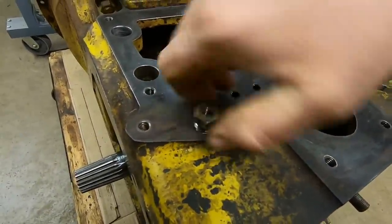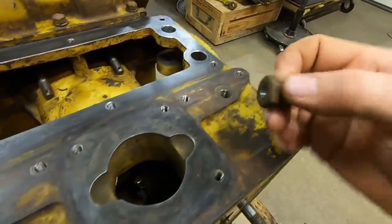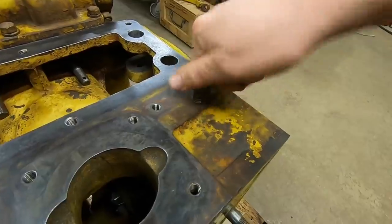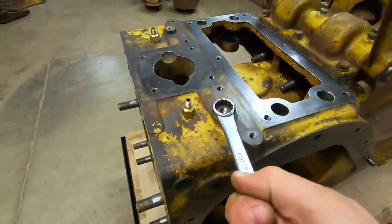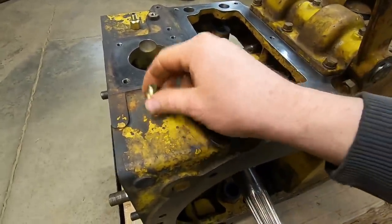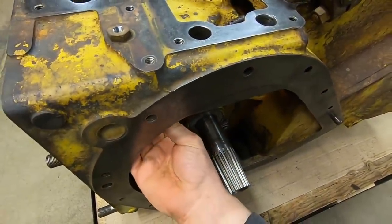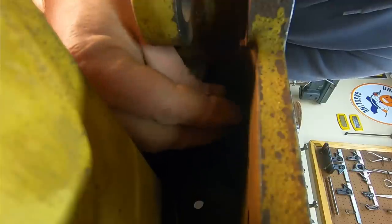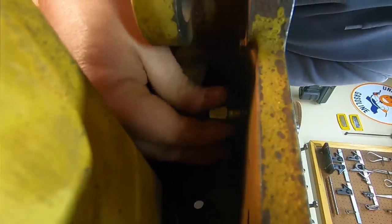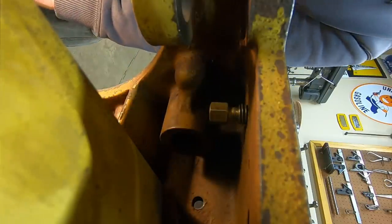These fittings go in first. Again, this first-gen design — the later cases did away with these large fittings and just went straight pipe thread right through this area of the case, threading everything right into the heavy cast. Much more efficient setup. With both of those tight, next come the brass line fittings — they thread onto the bottoms of these fittings up inside the case. Due to the difficulty of this shot, we're only catching this one on camera. Working by braille a little bit — we'll tighten this in with a wrench, but there's no way to fit the camera in here at the same time.